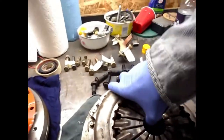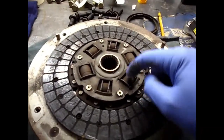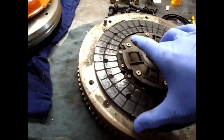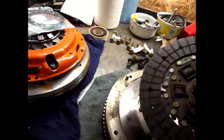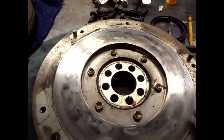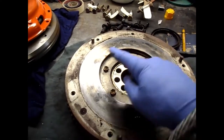Here's the old Toyota clutch. It has these rubber pucks. The reason I'm changing it — you can see burn marks on here; it was slipping quite a bit and actually starting to burn.